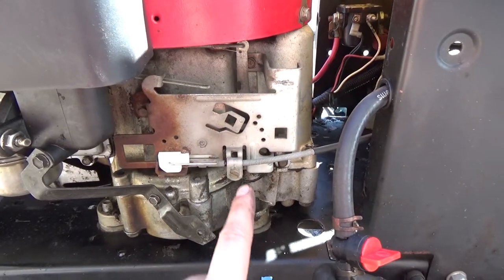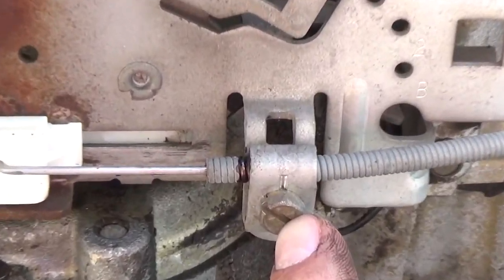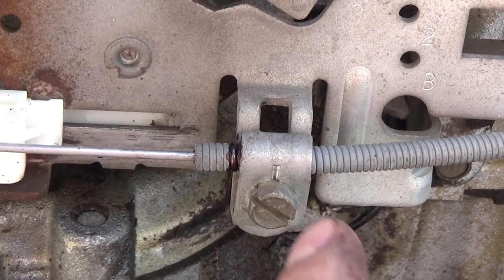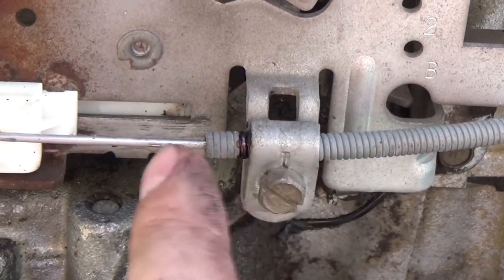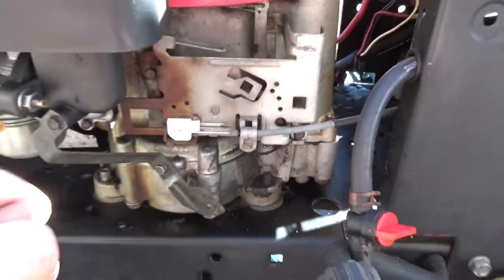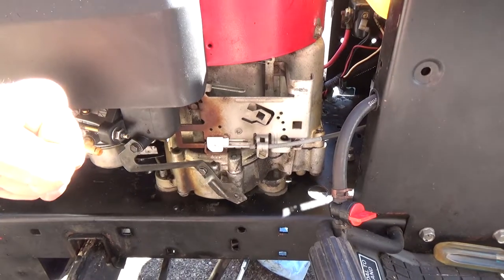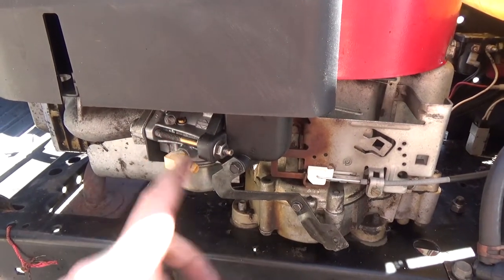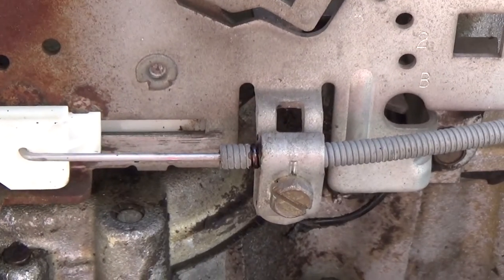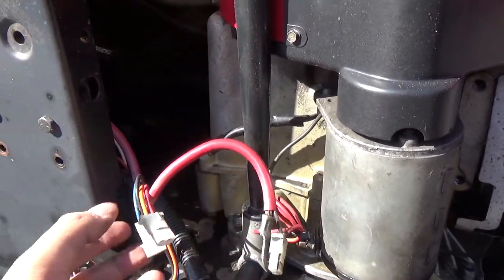I've got the fuel line removed now. Now we're ready to remove our throttle cable. A quick little tip: take a little permanent marker and mark just right ahead of where the cable is on this little mounting bracket, so that when you take it off and go to put it back on, you'll put it in the exact same position. If you put it farther forward, your lever on the dashboard is going to put the throttle in a different position — it could push your butterfly valves on your carburetor even farther forward. So we mark it, and we've removed our starter cable and unplugged all the little connectors.